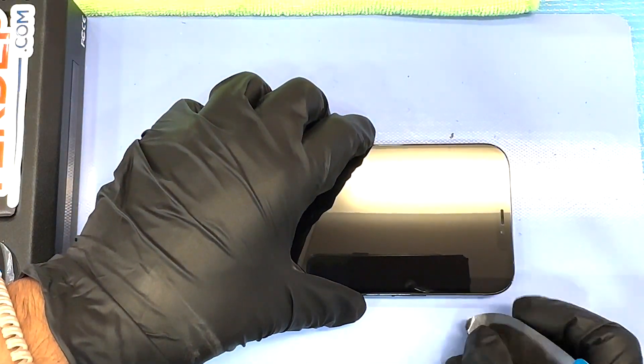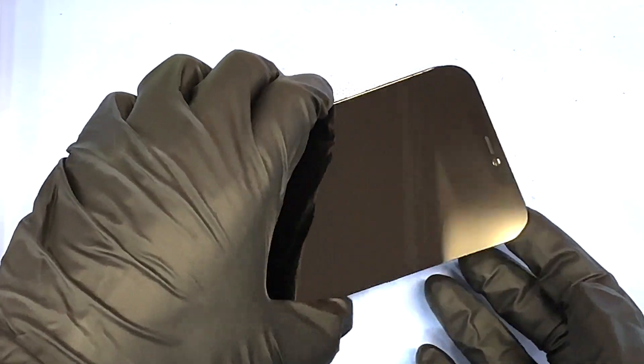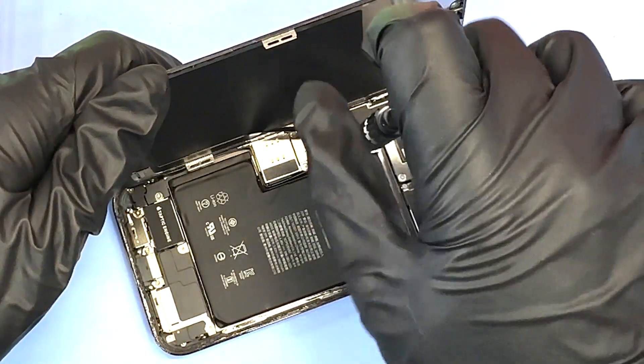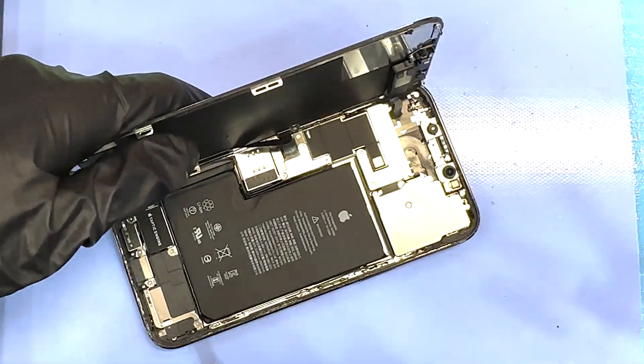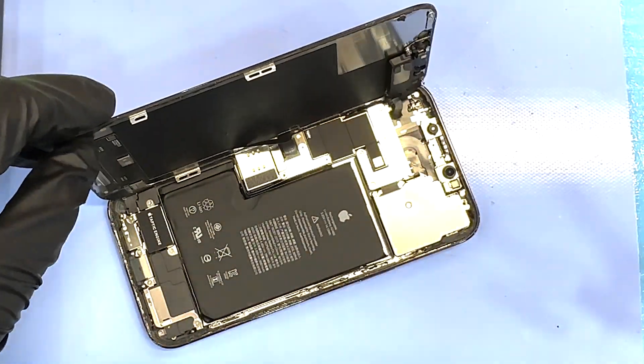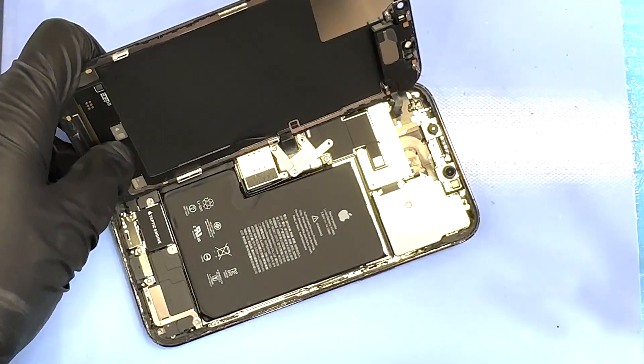And if all goes well, it should open just like a book. There we go. Now that it's open, we are removing the tri-wing screws for the main board, again using a 0.8 millimeter screwdriver. 0.8 millimeters is generally the preferable size for disassembling this phone — pentalobe and tri-wing across the board.